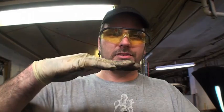The main things to watch out for, particularly when you're using the spring compressors, is that they can be dangerous. You have to make sure that you're using them properly. Also, there are other types out there that actually lock onto the spring, because what you're worried about is as you put tension on the spring, it slides from one direction to the other and allows the spring to open up at least on one side. But the bigger around the spring is, the less apt you are to have a problem, or the easier they will be to compress. It's the smaller ones, like on Hondas, that you have to compress the heck out of.